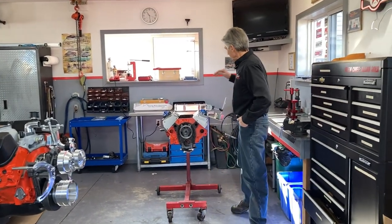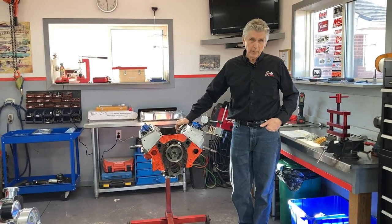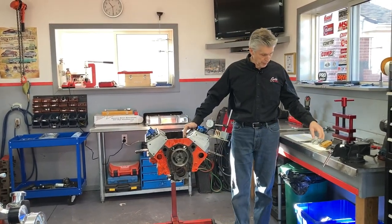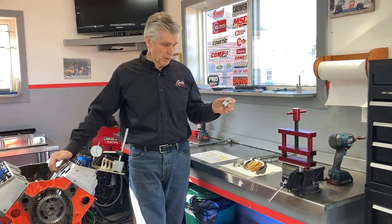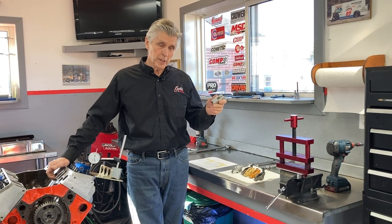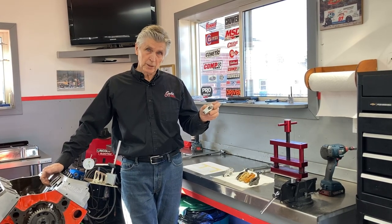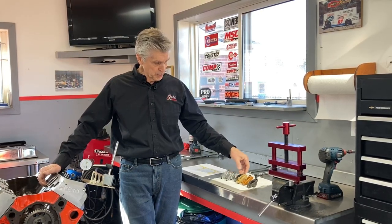Back to the subject at hand. Here's my mock-up. I've also talked about building a 400 small block and this is the 400 small block. I'm waiting for rotating assembly parts, and while I'm doing that, I'm doing a little bit of a science project on rocker arm ratio. So before I show you the results, first I'll show you what I'm going to compare. This is a GM Performance aluminum rocker arm - these are the rocker arms you get if you buy a ZZ383, a ZZ6, a 604 race engine. They're very expensive, full roller rockers, and these ones actually come out of my race car. Next is exactly the same thing, only a 1.6 rocker arm ratio. The standard ratio for a small block is 1.5, so these are 1.6.